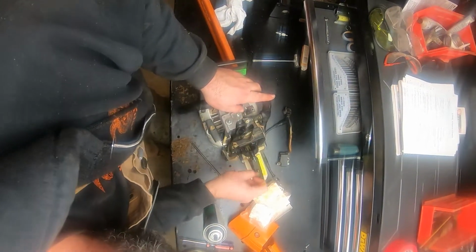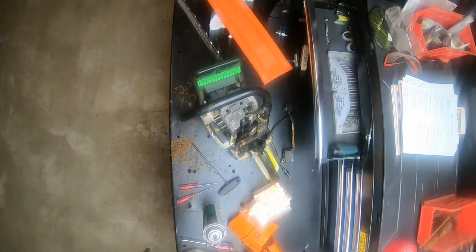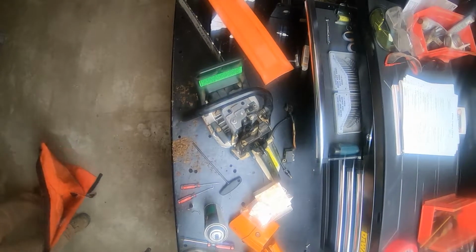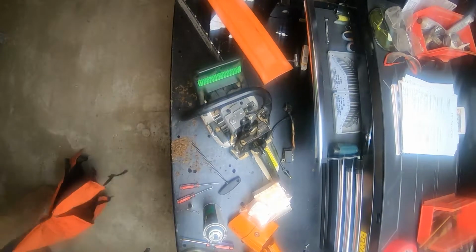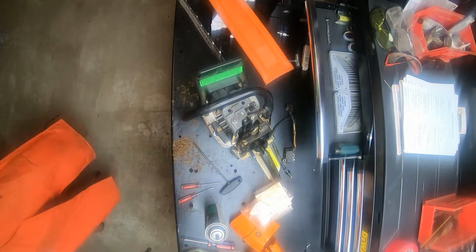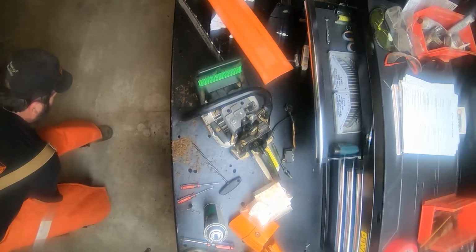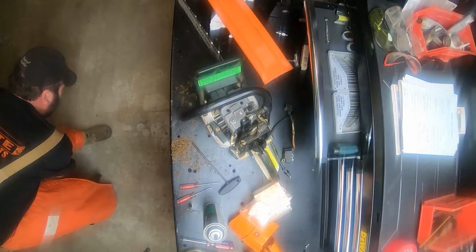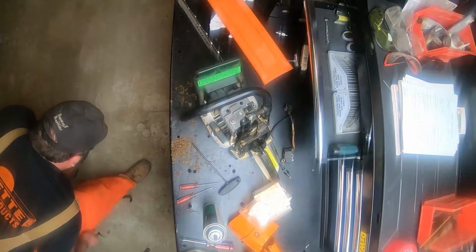Make sure I don't need dirt laying in there. All right. This attached real quick. Shed this jacket. My goodness, it gets hot in here. That heat works. Now we wouldn't run this saw very long without that piece of plastic on the top, because that's what directs air from the fan across all the cooling fins. We just want to make sure it's going to run.